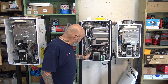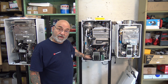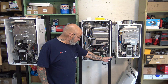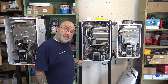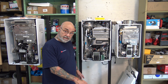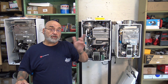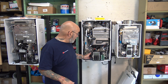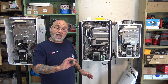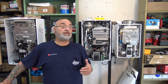Inside this polymer housing attached to the pump is a built-in check valve. The NPEA2 has cold water on the right, hot water on the left, and then three inches center-to-center from the hot is the dedicated return line. With other units you would use external check valves, but here you put the return right back into the unit itself. That check valve is there to prevent cold water from bleeding over into the hot.